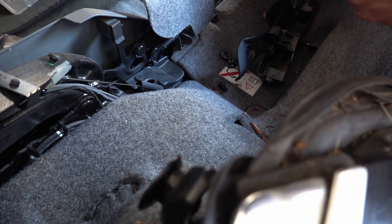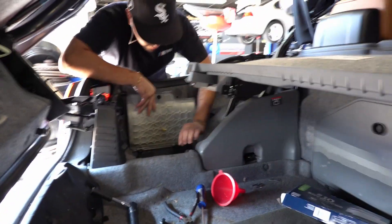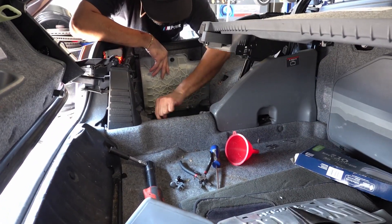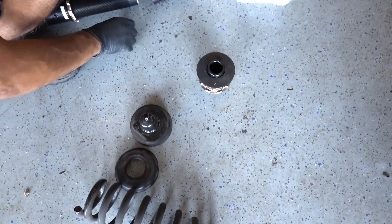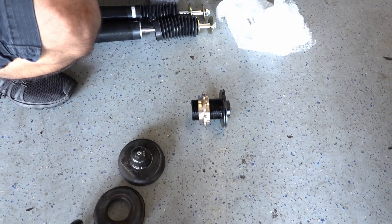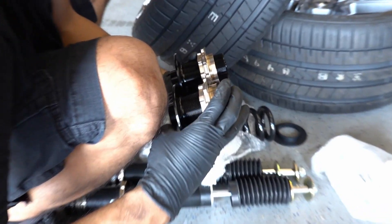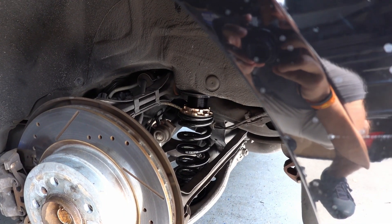This is definitely the part I had the most curiosity about with the rear suspension. Angel locates where the rear strut mounts are under all the trunk covering. He's comparing the size of the old and new struts to make sure they come pre-loaded at the same setting, because sometimes they say they do and they're actually different. As you can see, unlike the front coilovers, the rear ones have the strut and spring mounted separately.